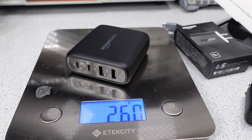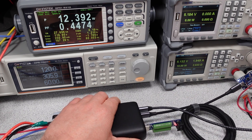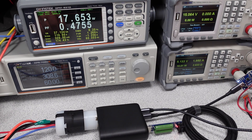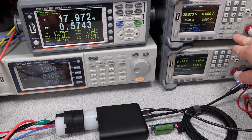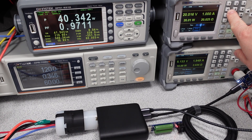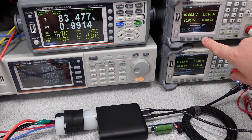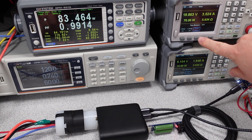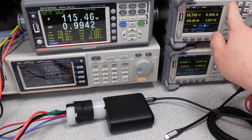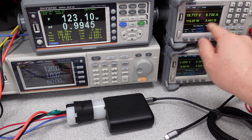The 100-watt adapter is on the larger and heavier side. While most of these power adapters have one port, the larger ones have more than one port. The power sharing is unique with these devices. Instead of renegotiating the power delivery on plug or unplug of a port, it renegotiates only when power is delivered. So when I turn on the demand for a few watts on the second port, the first port voltage resets. I can plug and unplug all I want and the renegotiation doesn't happen until the power is used. The overload condition changes with more things plugged in, so you can't pull more than 65 watts out of the top port once you have something else plugged in.